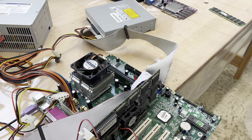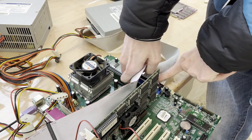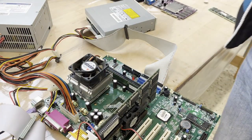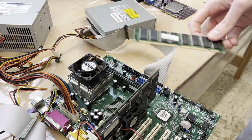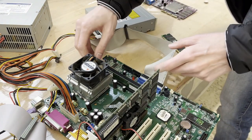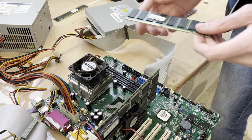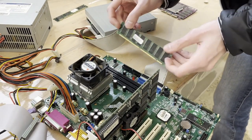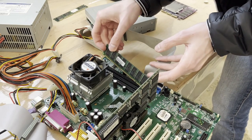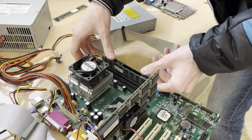This beeping could be a lot of things, but a good thing to try out is the RAM, to see if maybe the RAM has an issue or it's got a dead RAM stick. So as it turns out, I do have this type of RAM, only this one stick though. That's an SDRAM. It's very popular with Macs as well, so it's probably from the same time. And this one, we'll pull out and set it aside. And I know for a fact that this one does work just fine. So let's also put it in a different slot just to see. Maybe it only was the slot. And does it click?